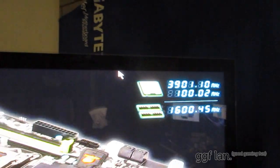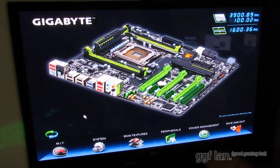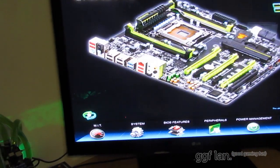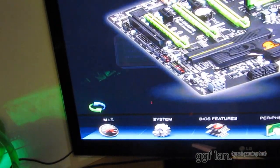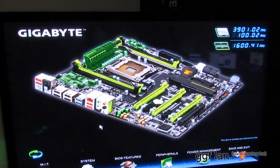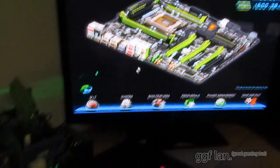As you can see, it's running at about 3.9. I do have an overclock on this, so I'll go in and have a look. You can also click on a little refresh-style button that just rotates the board to a different view. This is your basic mode. To go into the advanced settings similar to your older boards, hit Escape.